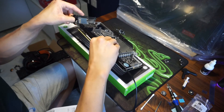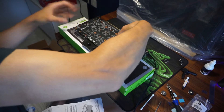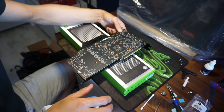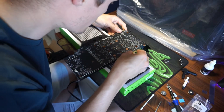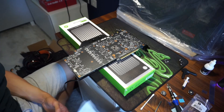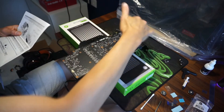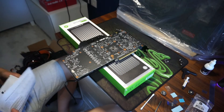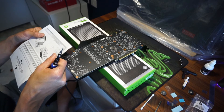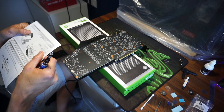We can flip this over now — being very careful. Now we've got 13 screws that need to go into all the different holes, and they've all got plastic washers on them. The instructions say to start tightening the screws around the GPU core and continue outwards, using a plastic washer under each and every screw. If the washer is already present on the circuit board — usually around the GPU — then no additional washer is needed.